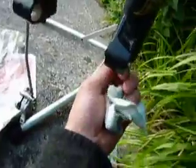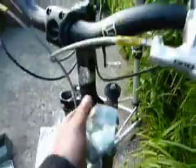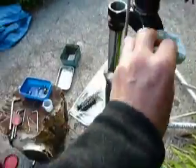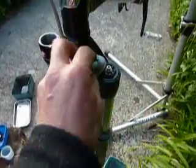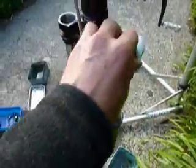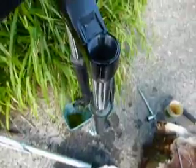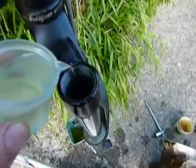Got the fluid in and the bolt up, and I've just got to extend the fork now and tighten the top cap. Top cap back on — just got to put the little springs and the balls back in there and put the cover back on the U-turn lever. And 200cc of 5-weight to go in there — that's the last one going in now.